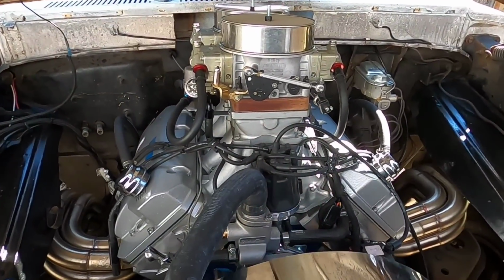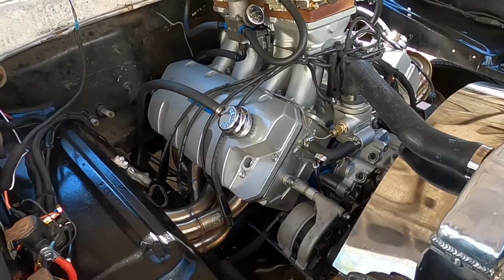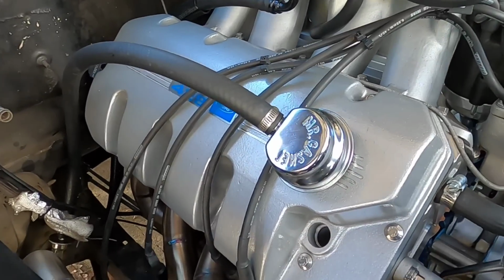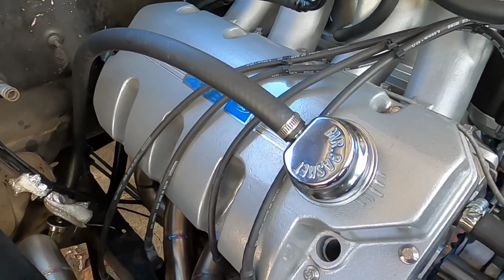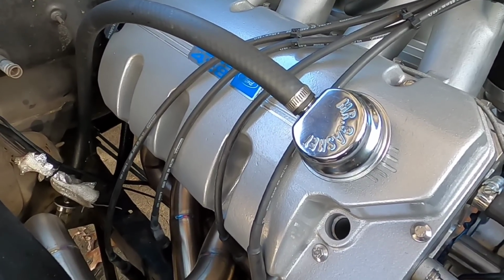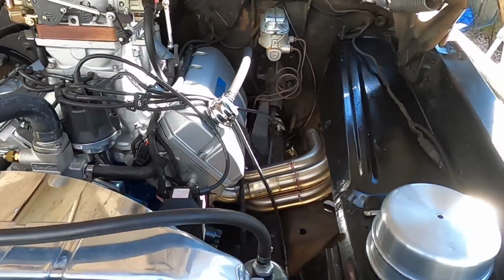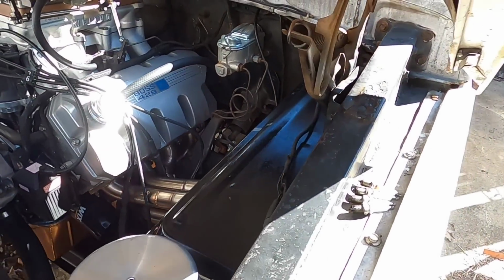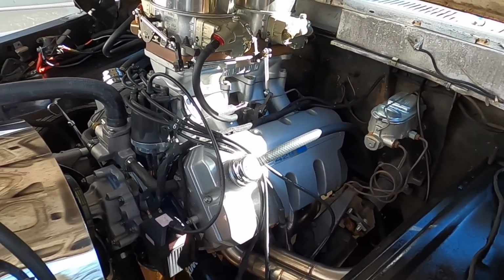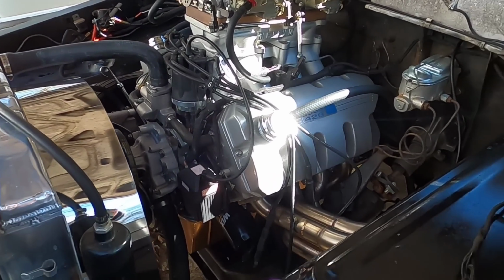All right, so I just pulled the plugs out of this thing. One of the most beautiful things is being able to pull plugs out that easy, being up here. But it also presented to me another problem. Yeah, check this out. So we've had torrential downpours for like the last 2 days, give or take. And spark plug holes filling up with water.